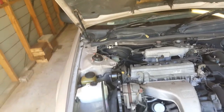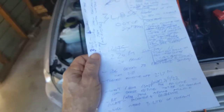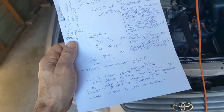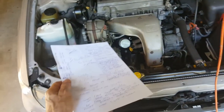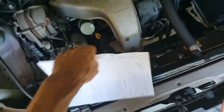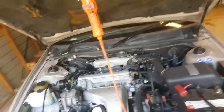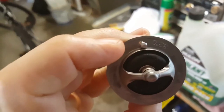The full mark is just there on the reservoir. On my notes it says at 156 I began to pressurize the cooling system and I turned the engine off at 217 — so it's a little more than 15 minutes, say 20 minutes for the engine to pressurize. You need it to pressurize to look for any leaks at the thermostat join.